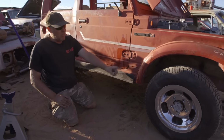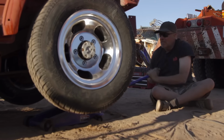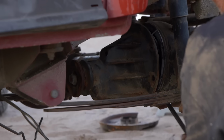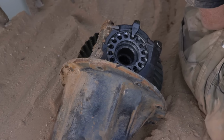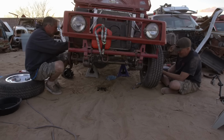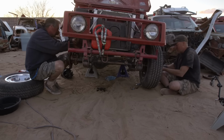But I have a solution, which is, this is a four-wheel drive front axle with freewheeling hubs and everything. We're gonna be able to take it apart, pull the axles out of it, and pull the whole center section out of the axle and drive around with nothing but just the front axle in the car. Okie dokie. Should be good to go. Everything was easy to take apart. You could run into a real headache trying to do that job.